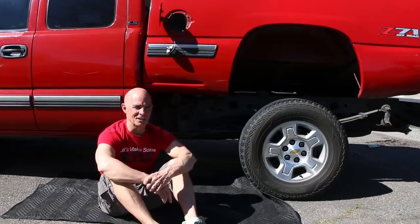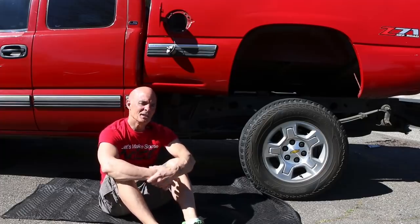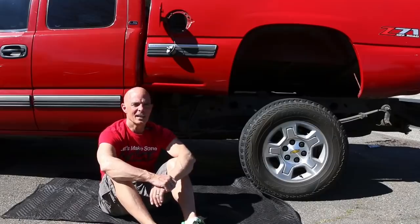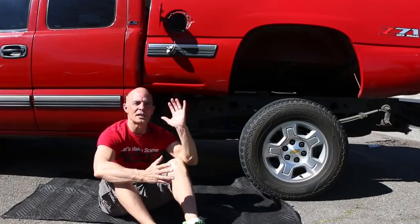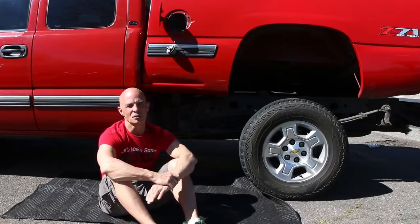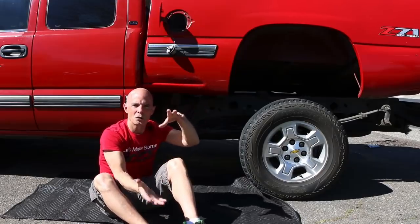If you do the math and look at it objectively, there's a reason it didn't. This supercharger was designed to run on a 240 horsepower V6 application. Any positive displacement supercharger basically just moves air from one side of the blower to the other. In a twin screw, there's actually internal compression, which is really good and makes them very efficient. But a Roots blower grabs air from the top side of the blower and moves it over to the bottom side.